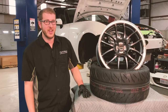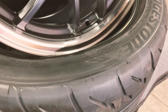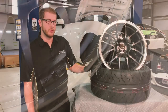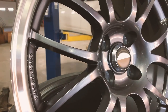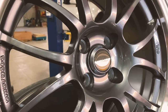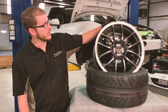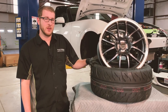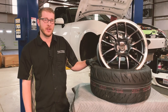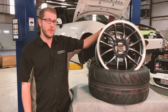Now we're on to wheels and tires. Our choice of tire for the ND V8s is the Bridgestone Potenza RE71R. We're using a 245-40 R17, and we're going to wrap that around a 17 by 9 inch wheel with a 45 millimeter offset — in this case a 949 6UL wheel, the Beryllium LE. The LE is the machined lip with the beryllium center. We use this combo because it's lightweight and attractive, and we specifically use this tire because it is an excellent street and track tire. It has a 200 treadwear rating, so it's plenty sticky but does have good tread for the street as well. It's an excellent package for these cars.